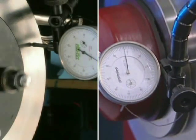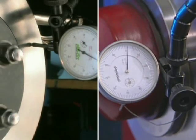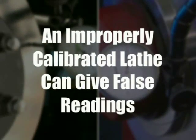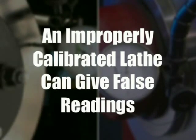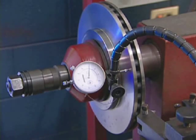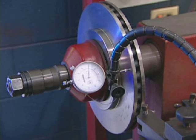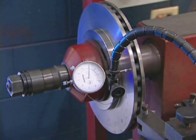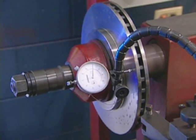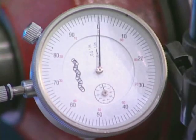When testing a rotor on a lathe, it's important to ensure the lathe itself is correctly calibrated. If a rotor is tested on a vehicle, the same measurements should come up on the lathe. An improperly calibrated lathe can give a good rotor false readings. Here are a few examples, each involving a good rotor with acceptable measurements, and how a lathe can produce two different results. In the first example, a rotor being checked on the lathe is receiving acceptable readings and is ready to install on the vehicle. The lathe and adapters perform their job because both are calibrated correctly.